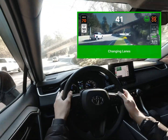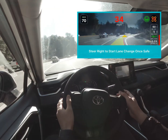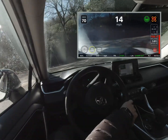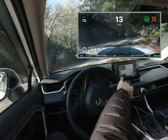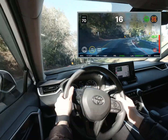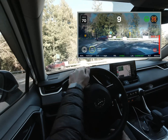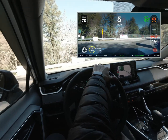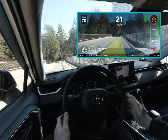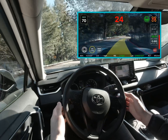I disable the adaptive cruise control for this hairpin exit. I keep the steering enabled but I do override it. There was no way I had enough torque to make this turn. Comma limits how much torque the car can provide, but pretty soon Comma will be relaxing those rules, and then hopefully my car can make these slow maneuvers. You'll notice I still don't have the adaptive cruise control on, but the car is still steering for itself — that's the Sunny Pilot MADS in action.